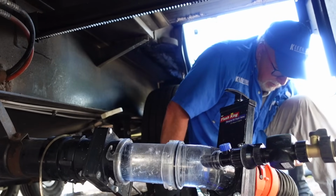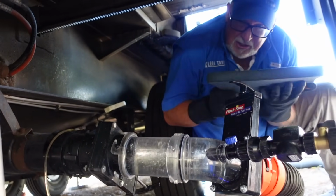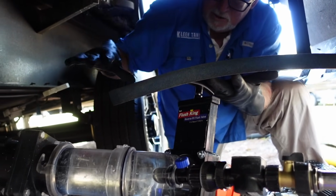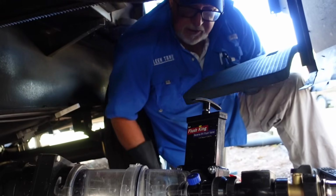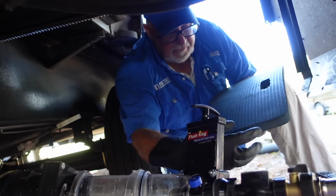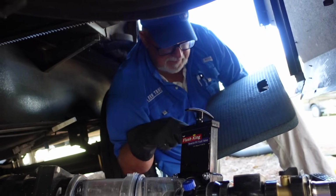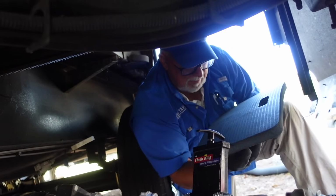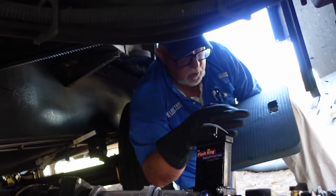Yeah, so let me use a little visual aid for you here. Let's pretend that this is your tank. They're a little wide this way, longer in the back, and not very thick. So if this is your tank in your RV, and this is pretty much the same in any RV, they tilt down towards the front where the hole is. Sure. And that's how stuff gets out. But stuff tends to accumulate down in these corners and on the bottom. And unfortunately, the sensors are actually placed here in the corners.